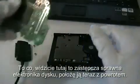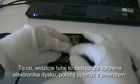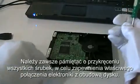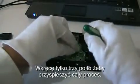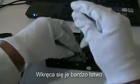What I have here is a replacement circuit board, and this is a working circuit board. I'll put it back on now. You should always put back all the screws that are removed from the circuit board to ensure proper contact. I'm only putting back three here to speed up the process, and it screws in very easily — there's no need to apply a lot of pressure.